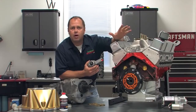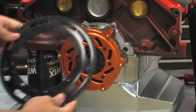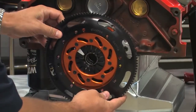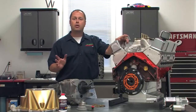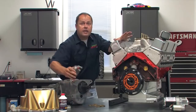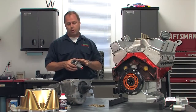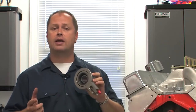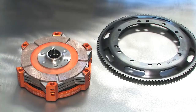Quartermaster's racing clutches are definitely a marvel of engineering. They're incredibly small and lightweight for the ultimate in low rotating mass, yet they can handle a ton of horsepower. But no clutch, no matter how high quality, is going to last very long if you don't set the throw-out bearing clearance properly. A throw-out bearing that's set improperly will never let the clutch fully disengage or fully engage — either way, it's going to wear too fast.